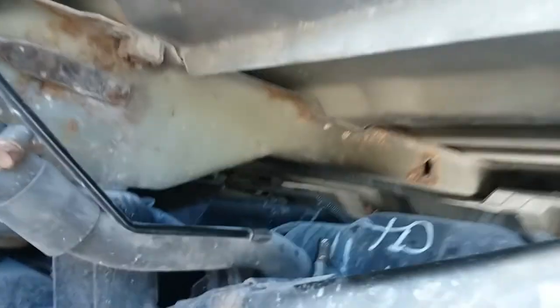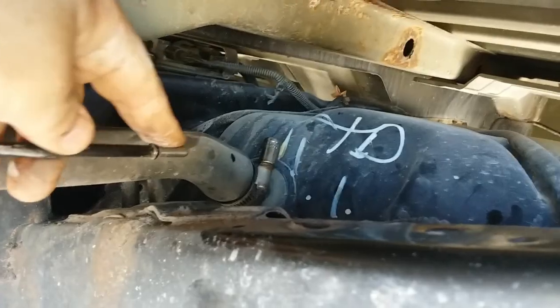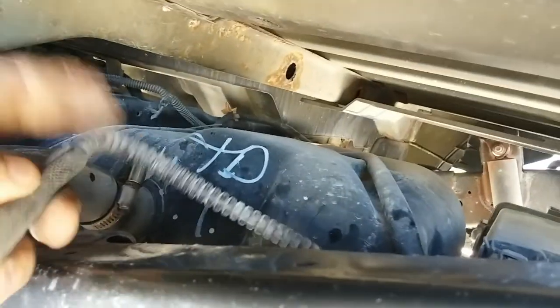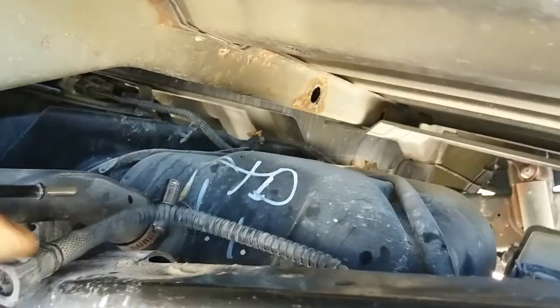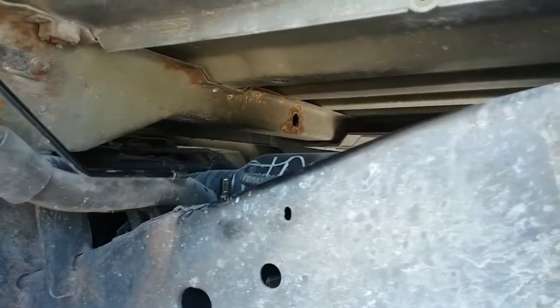Then you reach up in here, and this hose clamp, you undo this hose clamp and this breather tube with just a piece of plastic. It just pops right on off there. You just squeeze the tabs right here. Squeeze the tabs and it slides right on off. But like any project, you can't do it one-handed, so I'll get back to you here in a few minutes whenever I get a little bit more done.